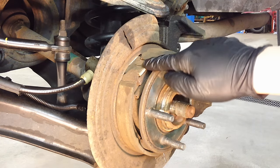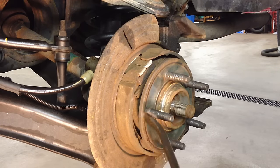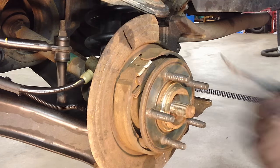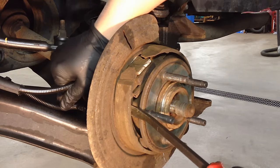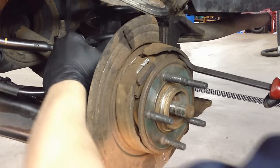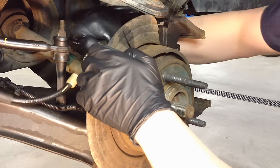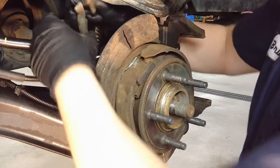At this point we need to pull the parking brake actuator out. We're going to spread the shoes to the side and push it out, and it'll just flop to the side. You pry off of the actual hub and bearing, pry it out a little bit, then start pushing it through. It may get stuck because the rubber boot will bind.